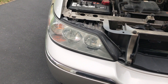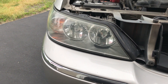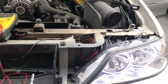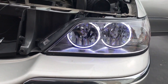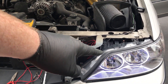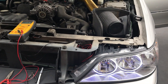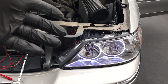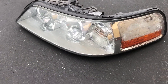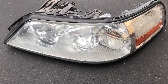Here's our old boring headlight with the parking light on, and you can see that it's pretty hazy — the whole lens. That's why I'm replacing them. Here's the replacement one, and you can see I got the angel eyes going. What I did was I just used my ohmmeter, checked voltages with the thing unplugged, and found where the parking lights were. Also when you turn on the regular lights, you'll also get light as well. Here's the old lens — it's filled with moisture, the headlight was out, it's just hazy. It's time to retire these things.